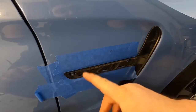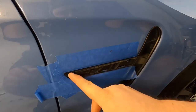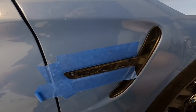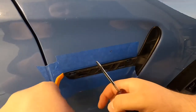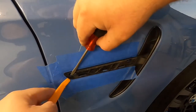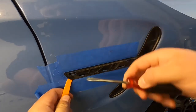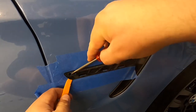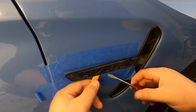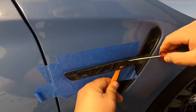Next, we're going to jump into removing the housing because we are replacing that as well. The only thing holding this on is one, two, and three clips. This is where our flathead comes in. All we're going to do is take our trim tool to get under the black piece of plastic and try to pull it up, just so I can get my trim tool underneath it — just to give it some outward force. Then all you do is push down on the tabs. Just give it some outward force and then push down on the tab.